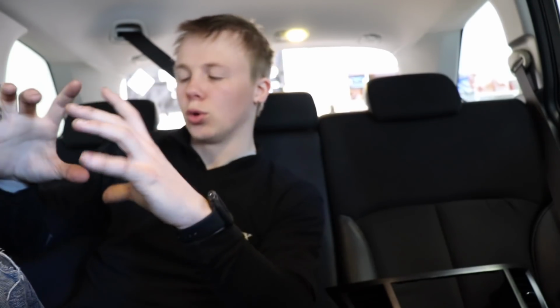It's just certain parts of the car hitting their resonant frequency and moving with the music. These speakers have a lot of power going to them, and it's just getting to the doors. The best situation would really be to have an old car with metal doors, and you mount the speaker through the door card, screwed into the metal of the door, rather than being behind all of these loose plastic bits. But that's just the way it is with these Japanese plastic cars.